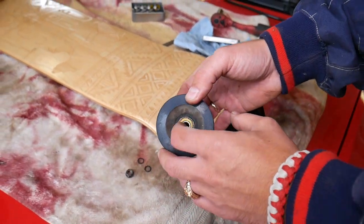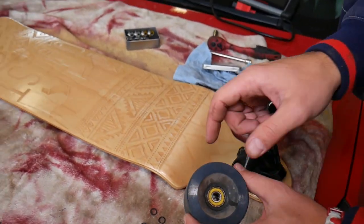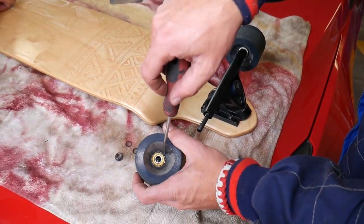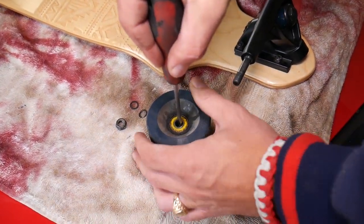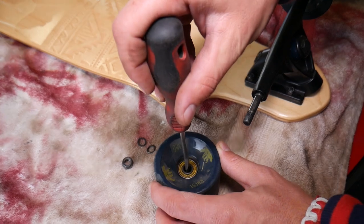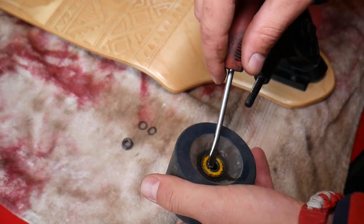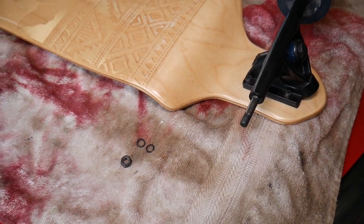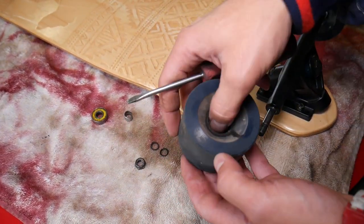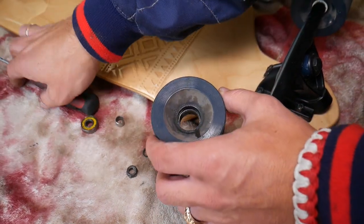Here we have the wheel and you have the bearings on each side, with a spacer inside. I'll get a screwdriver that's going to fit here and I'll show you how to push the bearings out. I go in on the spacer — you can see it inside — and gently tap it. The bearing is almost out. You can grab it with the screwdriver and pry a little bit if they're stuck. This is the spacer — it's very important to have the correct size spacers and the correct size bearings. Push the other one out with your finger.